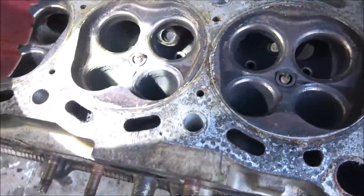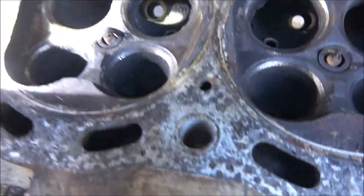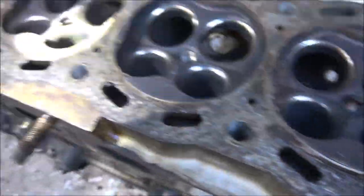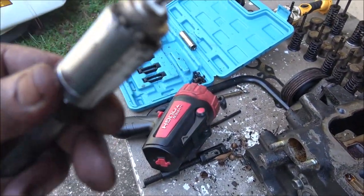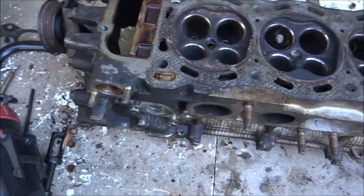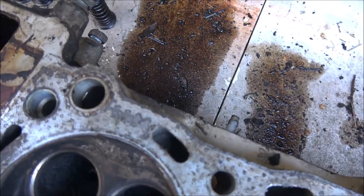And I was looking at these spark plugs, number 3 and 4, and they look good, really good. And number 2 I took out and put in the vet, and it looked just the same as these two. This one I could never tell because I broke the plug trying to get it out. But what are you going to do? You have to do something. But from the looks of that, it wasn't too bad either. There was a lot of carbon on the exhaust side, of course. That's to be expected.